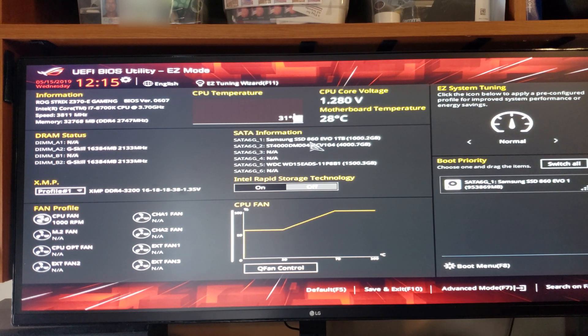So I'm not going to get the kind of performance I expect out of an NVMe M.2 SSD. I've also got a four terabyte Seagate drive — a standard hard disk drive running at 7,200 RPMs — that's in channel two. And then in SATA channel five, I've got a Western Digital — I believe it's a 5,400 RPM — one and a half terabyte drive. So that's actually something, as you'll see in a moment, that I'm going to need to address in the configuration.